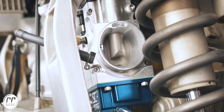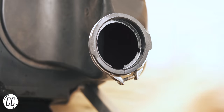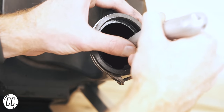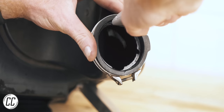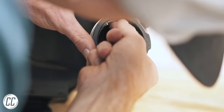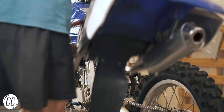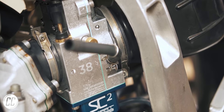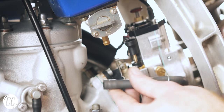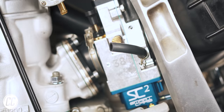The rear of the carb has a vent scoop that needs to be open to function. However, the YZ has a lip in its airboot that would block this, so it needs to be trimmed. Not all bikes would need trimming, but it's just the top bit that needs to go. I may have gone a bit overboard with it, but I didn't want it to be blocked at all. So with the subframe back on and the airboot tightened up, I could give it some fuel. The fuel line was now a tiny bit short, but thankfully the included fuel filter made up the difference.